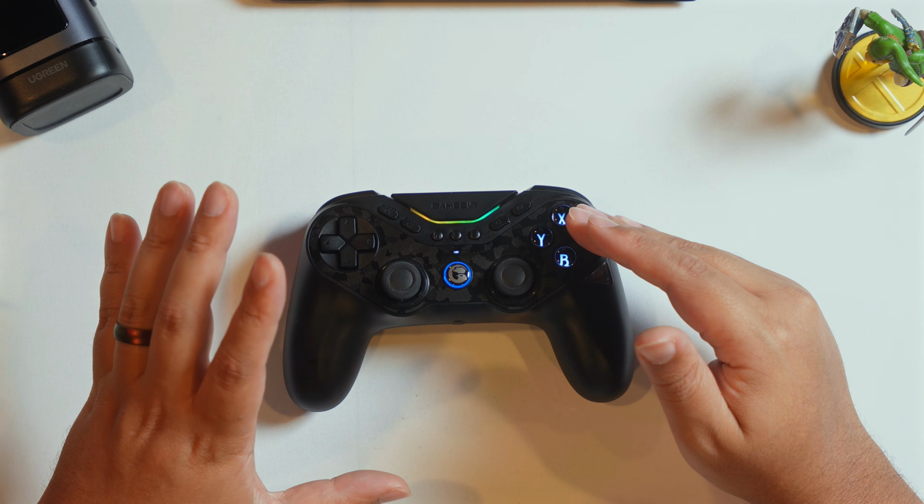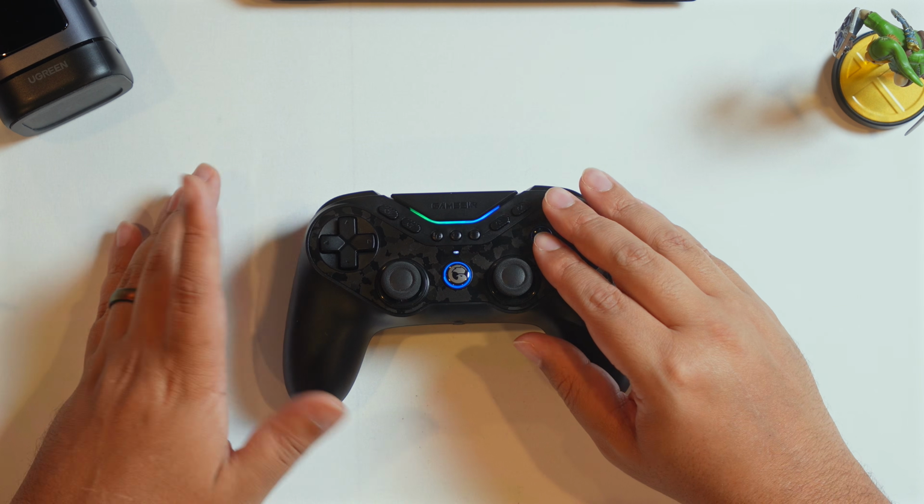It feels like it is, usually, at about the midpoint of your sticks, but once you get past the midpoint, it changes. So it's very common when playing with Hall Effects that you're trying to move just a little bit and then you push a little too far and suddenly your character moves way faster than you expected it to be. And that's due to the linearity of Hall Effect. Enters TMR. And this is what makes TMR so amazing.